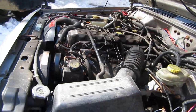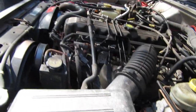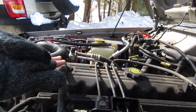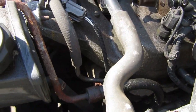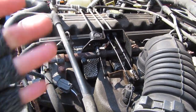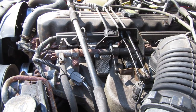I love the four-liter and I love it in a little light vehicle like the XJ, but you can just see there's no room anywhere. When this engine bay gets hot — even look at the hood, it just sits right down here. It's a reverse flow head, which means the hot exhaust manifold is right down there, and when heat rises, it goes straight up into the intake manifold and the fuel delivery system. And that's how heat soak manifests in an XJ.